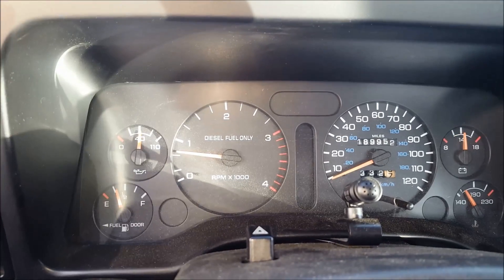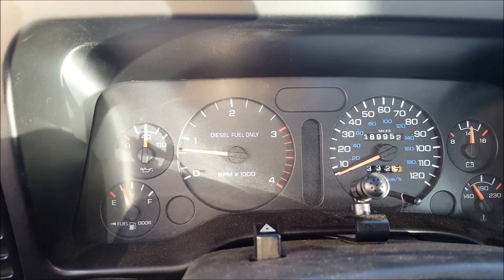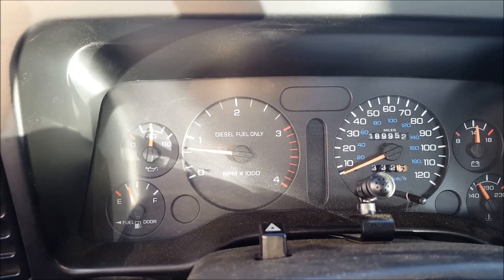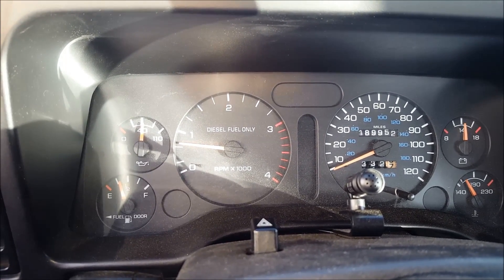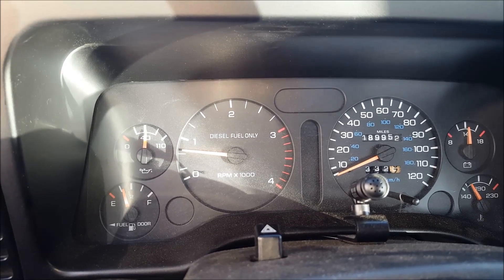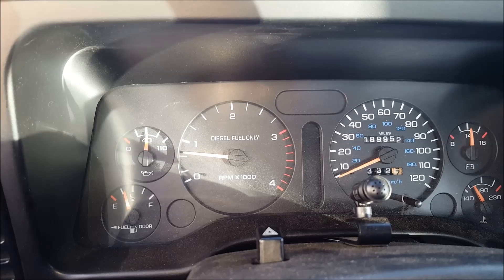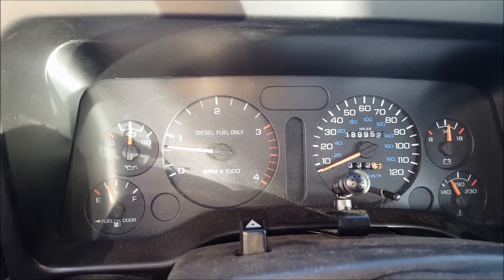With the 3K springs installed, I've got to say I'm pleasantly surprised with the increased drivability RPM range — it revs up to 3,400 RPM, just as described. For guys throwing 4K springs in there and doing the valve springs, unless you've got a race truck and you're dragging this thing, forget about it. The 3K springs give you much better drivability and you don't have to mess with the valve springs. This is a big engine — it doesn't need to be up above 3,200–3,400 RPM anyway. Until next time guys — KZGuy2, no-nonsense know-how. Give me a thumbs up if you liked it. Thanks, have a good day.